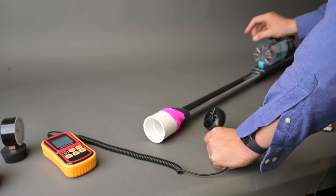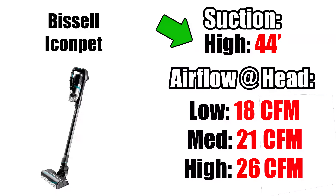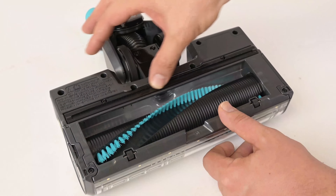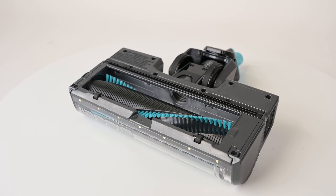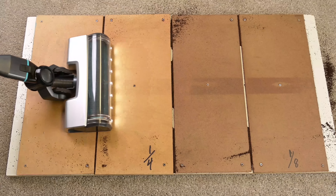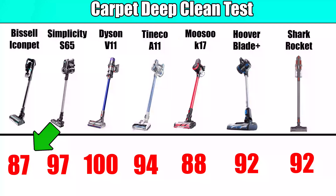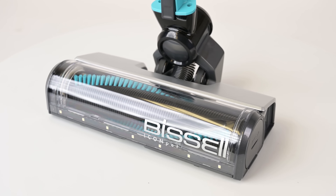Moving on to the cons, the main thing I didn't like was that it wasn't a particularly powerful vacuum. We measured its suction and airflow at various places on all settings and found 44 inches of suction on high power. Its airflow at the head ranged from 18 CFM to 26 CFM, which is pretty low — lower than most cordless vacuums on the market. The Bissell Icon Pet is really well-designed with things like the seal on the floor head, the minimal gate to retain airflow, and the super well-designed brush roll, which means it doesn't need to be very powerful to pick up debris. It was likely a strategic decision to keep airflow down for maximum battery life. That said, this lack of airflow showed up in the crevice pickup test, where it wasn't able to get debris from the quarter-inch crevice no matter how many passes were made. In the carpet deep clean test it scored 87 — actually pretty good considering the power, much better than I would have guessed — so kudos to the engineers at Bissell for getting the most out of the available airflow.